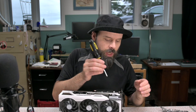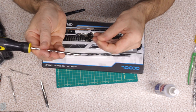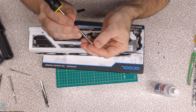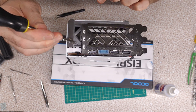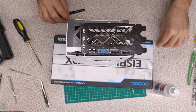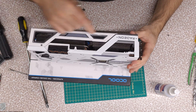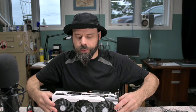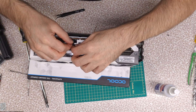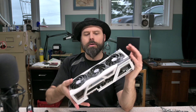If you have trouble with screws dropping, get a strong magnet and stick it near the end of the screwdriver — boom, now it's magnetic. The rest of the screws are semi-specialty: three black ones go up front and two tiny silver ones go in here. Now we just have to plug in the fan and lighting lines — and BAM, this card is back together, ready to be air cooled and popped into my system upstairs.